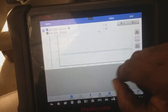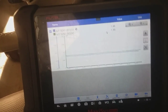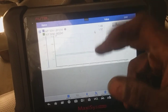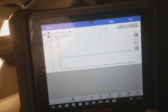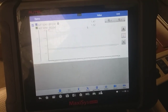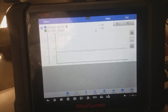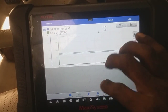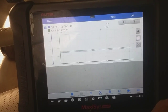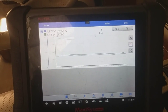It had that white soot, like a pin-sized mark around there, that showed there was a significant amount of heat being concentrated in one area for a prolonged period of time. Hence that spark, that arcing. Lo and behold, found the cylinder, replaced the coil boot. I was so confident that's what it was, not the coil. I just replaced the boot, a $10 part. Didn't really save too much if you were to buy a coil. Yes, you could, but I just wanted to prove how legitimate the repair was and isolate the issue by replacing the part only. So I didn't have to spend the additional $40, even if the coil was $50. Narrow it down, diagnose it, fix it efficiently.